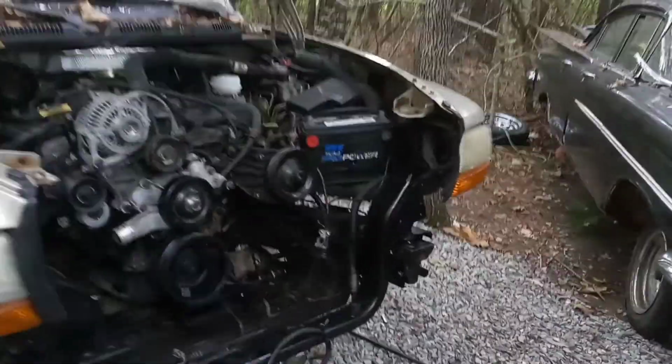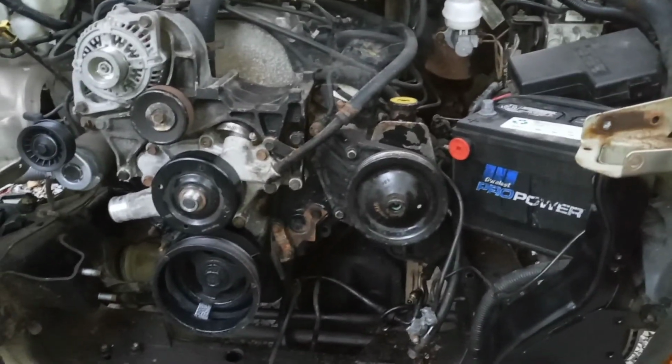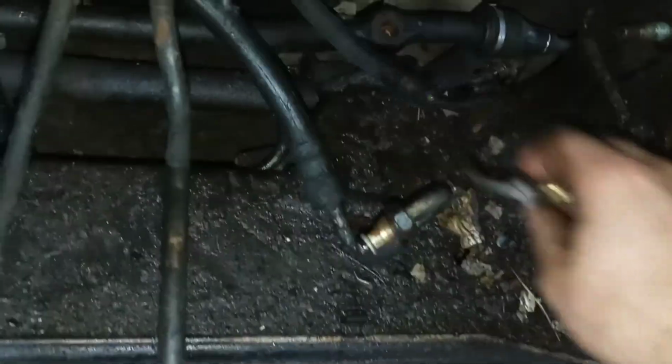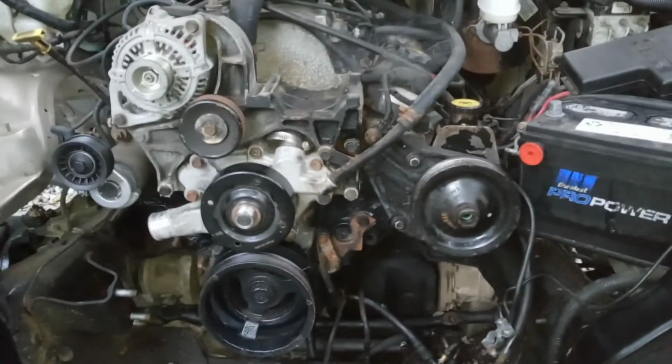But this is where we're at here. So now we got our pump, we got to get our pressure line hose, which is sitting down there. I'm not worried about the return, because we'll just cut the hose off this one here. We'll just replace that hose, and I got hose, but this one we will replace. That's probably what was leaking, not really the pump. But anyway, I went ahead and replaced everything on the front of this motor anyway, and you might as well do it right.